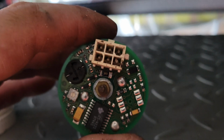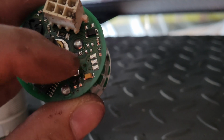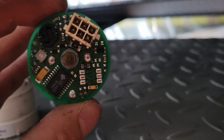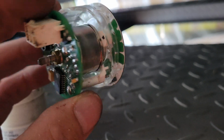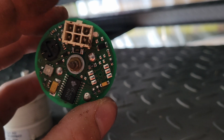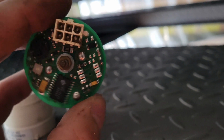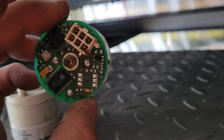And then here is our unit here. And from what I recall, it's been a few years, it was these ones here that need to be resoldered or reflowed. But that's okay. What we're going to do is we're going to go over every single one on this. And then obviously if that doesn't fix it, we'll need to replace the unit. But worst case scenario, if I gotta replace it, I do. But like I said, if we can save it somehow or another and save ourselves like 125 bucks for a used one, I'm definitely gonna do it.